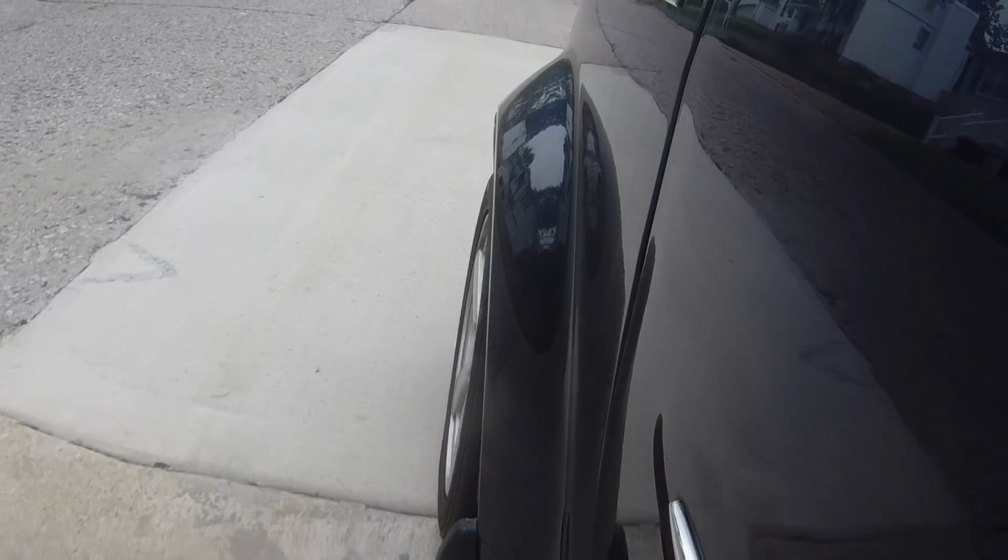It's now somewhat controllable on the highway, but it still pulls to the right. I thought I had this problem figured out because the left wheel would visibly toe in under acceleration, as you can see in this footage. The only problem is that I took this video after installing the new wheel bearing. Why is it still loose? To make things more complicated, I can't explain why it's pulling to the right so heavily, because the right wheel also has visible toe in under acceleration.